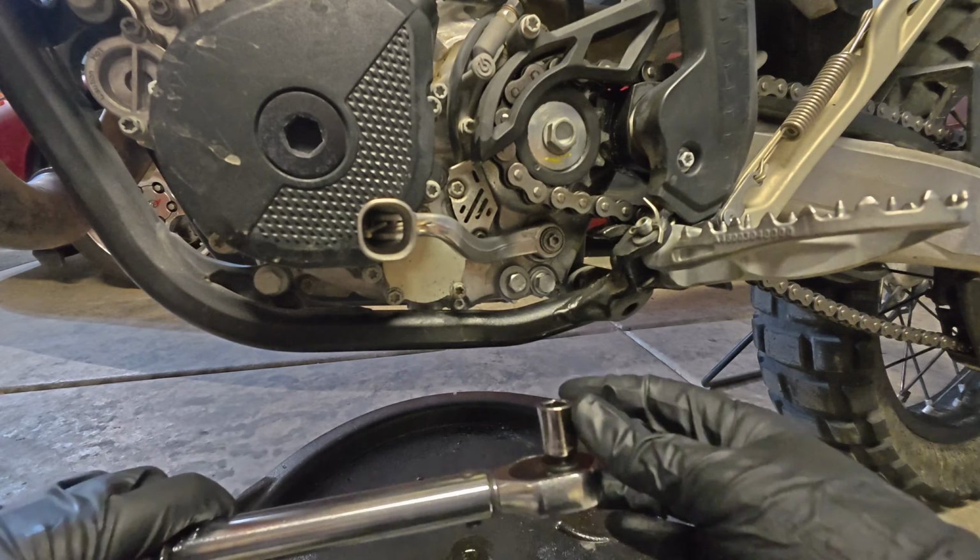Now, some people will pre-soak these oil filters. That's great as well. Nothing wrong with doing that. Other people say you don't need to do either. You can just put the filter in there and let the oil get pumped up through there. I'm not gonna say that won't work, but it's not ideal. I would rather prime the system, get some of this oil in the reservoir, and you could even go as far as also soaking the oil filter. That way you're limiting the amount of things that can go wrong as the system's priming.